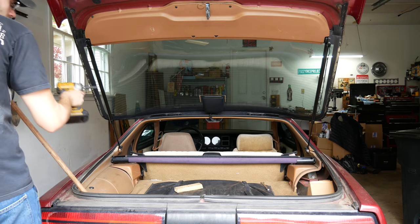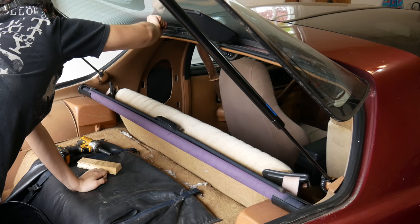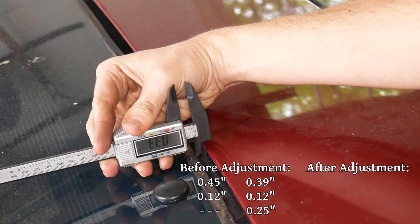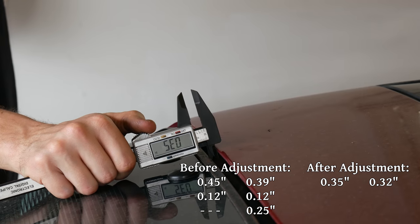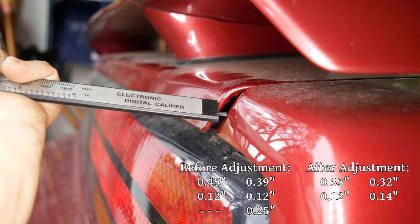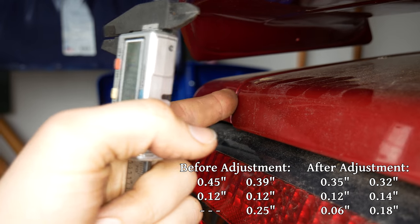With both of those back in place, we'll relieve the broomstick of its duty and reinstall the hatch strut. Now that the hatch is resting the way it's supposed to, we'll finish tightening the glass down on the hinges. We could go with the torque spec of 'shatter the glass then back off half a turn,' but instead we're just going to get them reasonably tight. With those in place we can finally close the hatch again and check the alignment. The roof gap at the passenger side hinge is 0.32 inches; at the driver side, 0.35. The trunk lid gap on the passenger side is 0.14 inches and on the driver side it's around 0.12. The overhang at the rear on the passenger side has decreased to 0.18 inches and on the driver side it's maybe a sixteenth of an inch — pretty close to flush.